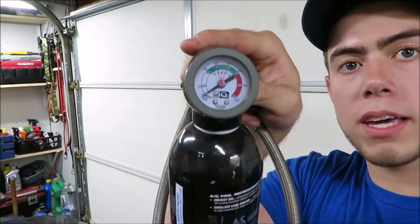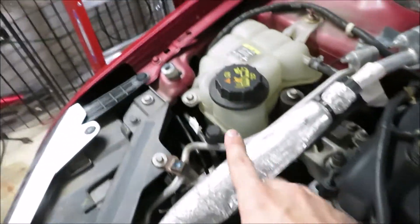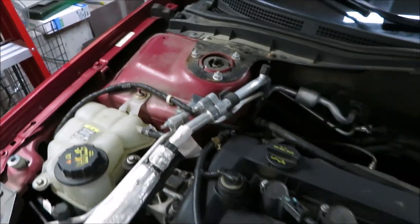You can go to your local auto parts store or Walmart and get the AC Pro kit. They have a gauge on it that reads the pressure in the system. You need to have the can with it so that when you plug it in, the stuff in the system doesn't spray out. You hook it up onto your high pressure or low pressure side, whatever the instructions say.